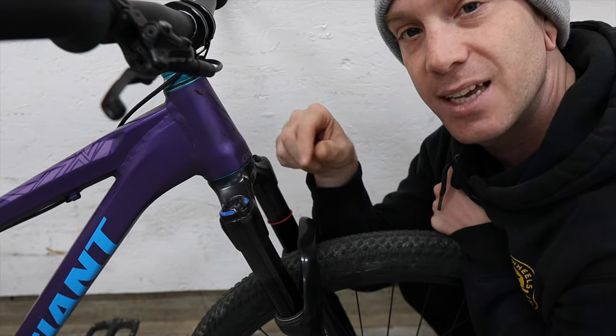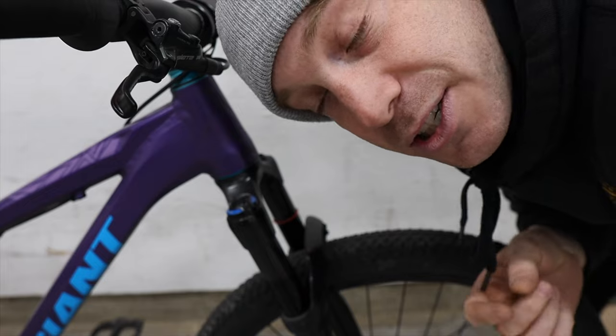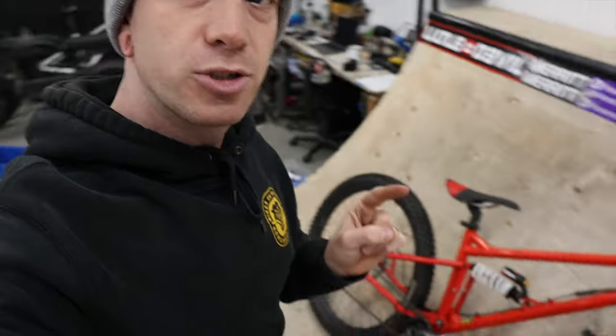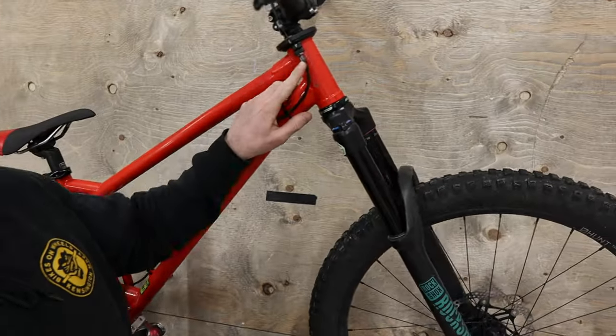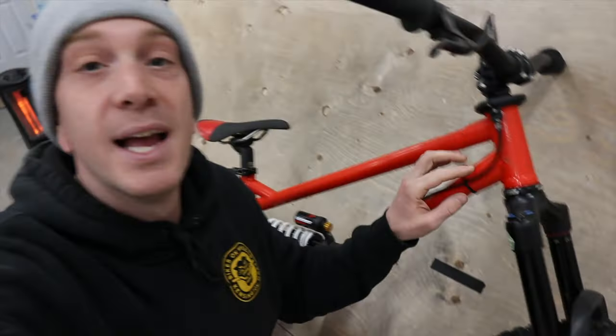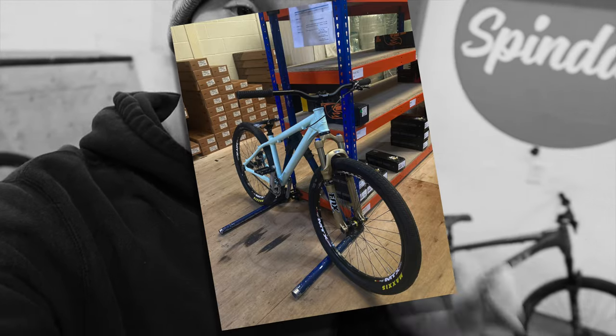When you look up the specs of the headset on this and order it, you're going to be able to get the one that fits. From the research I've done, the previous generation actually uses a straight steer, but it's a 44 millimeter straight steer — a lot like my slope duro bike. You can put in the larger lower external bearing cup and run a tapered fork anyway. I've seen some early generation STPs with tapered forks in them and they do look cool.